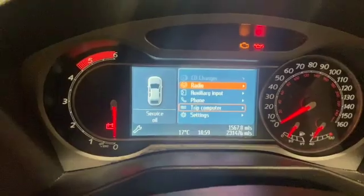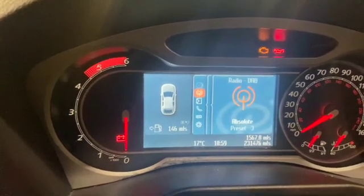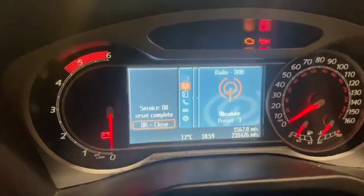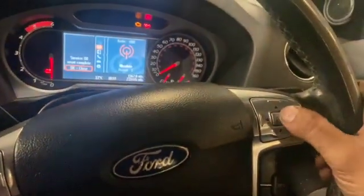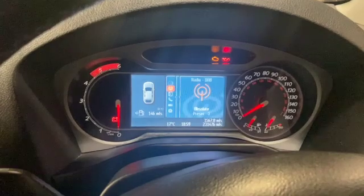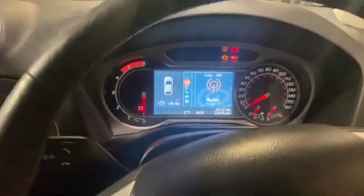It's pretty standard on a lot of Fords this. All you need to do is turn the ignition on — you can see it's saying 'service oil' — and press and hold the brake and the accelerator at the same time, keeping the pedals depressed. You'll get a message: 'service oil reset complete.' Press okay on the steering wheel to clear it. Nice easy reset on these. I hope the video helped — if it did, give it a quick thumbs up and subscribe to the channel. Check the description below for links to all the parts and tools used, and check out the video at the end for the cam belt replacement. Thanks for watching — see you next time.